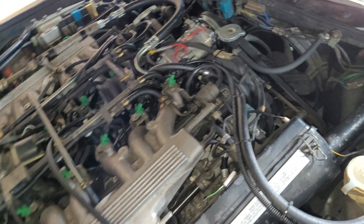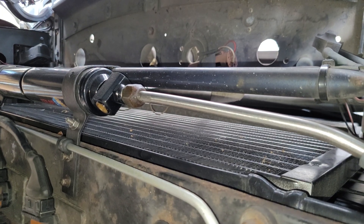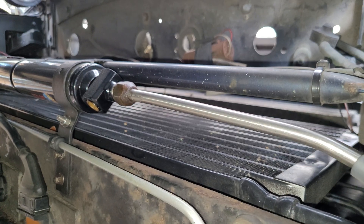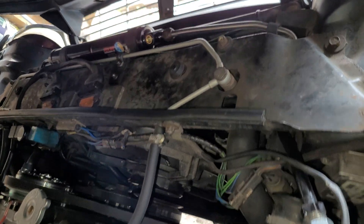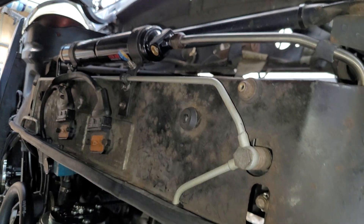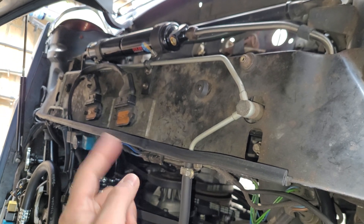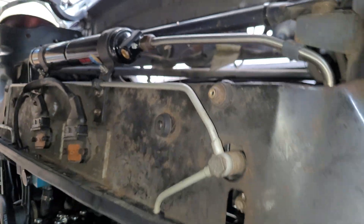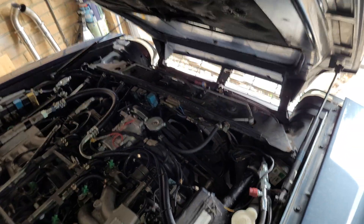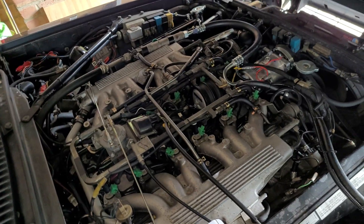The first thing any owner should do is ensure the radiator and AC condenser are not blocked. The AC condenser on my car is relatively new — I removed and replaced it because it had turned to grey dust. Between the radiator and AC condenser you can get a lot of leaves and debris build up, so you have to remove the panel, the bleed points, and wiring to access and clean between the AC condenser, oil cooler at the front, and coolant radiator behind.